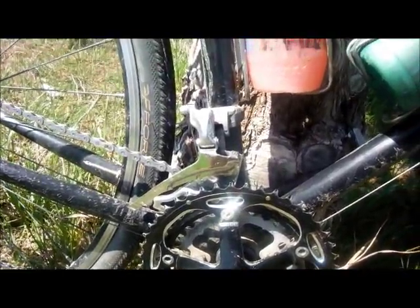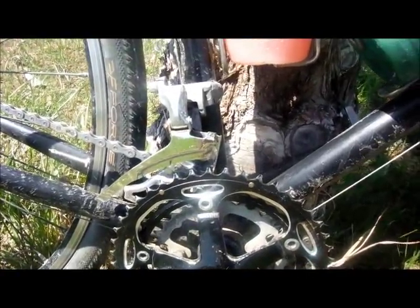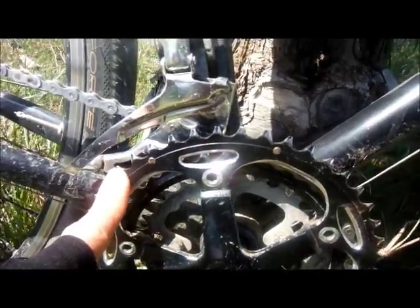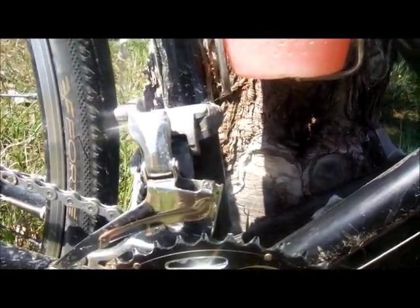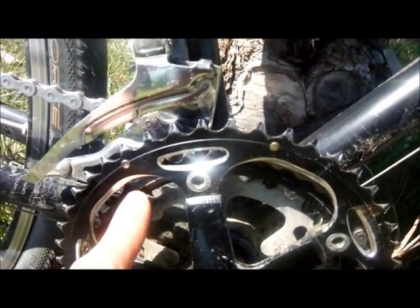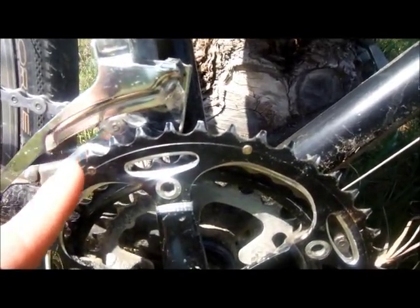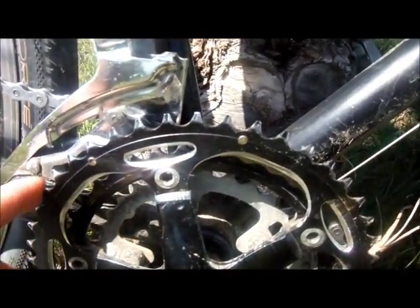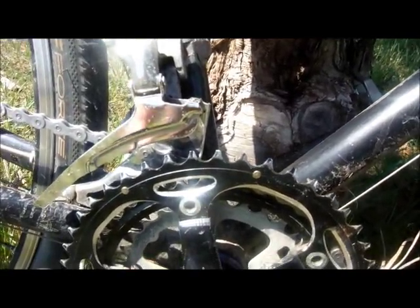I should say one more thing about my new cyclocross gearing and the front derailleur adjustment. I had mentioned before that the Shimano spec on the 5703 front derailleur says you have to have a minimum 11 tooth difference between the middle chain ring and the outside chain ring. And I don't, I've only got 8. I mentioned that's just a guideline, but there are a couple of things to consider there. I just wanted to throw this out.